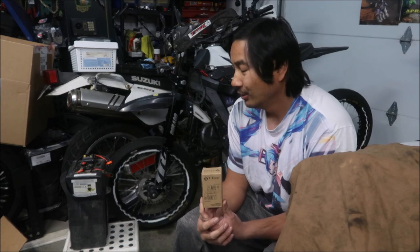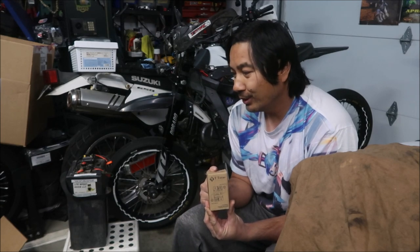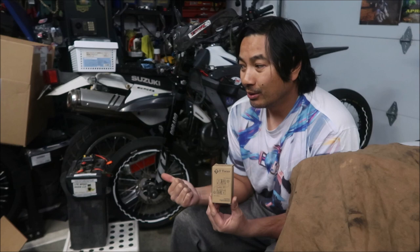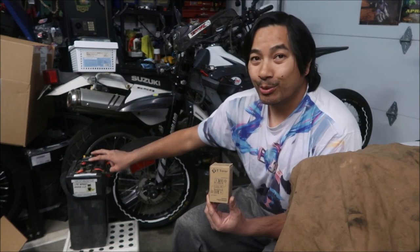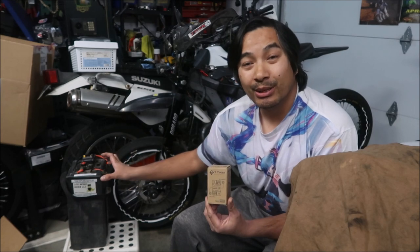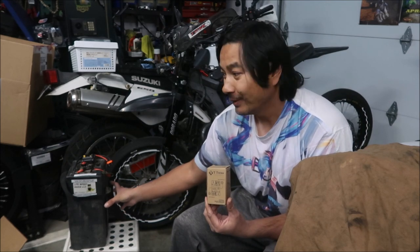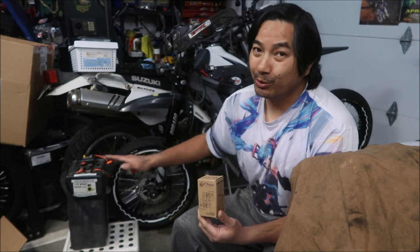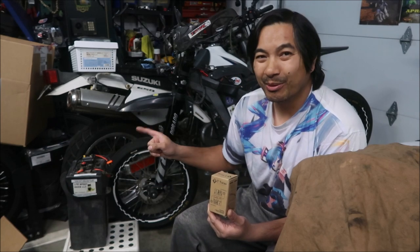Hayes Omega is planning to get a third battery — I need all the batteries for long electric bike races. After the swap I'll show what we're working with and then report back after test riding it. Hopefully the breaker is the problem, because if it's not, the next step would be checking the BMS or looking for a loose internal connection inside the battery. The easiest fix is just to change the breaker.